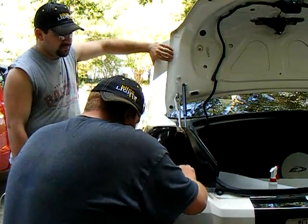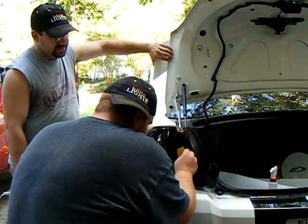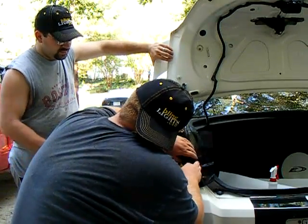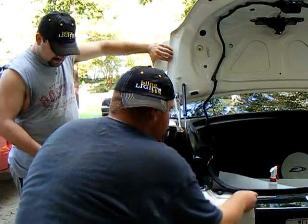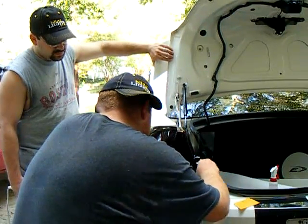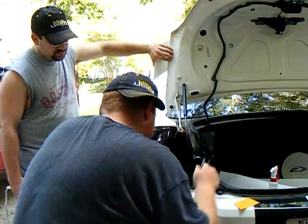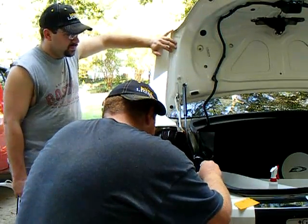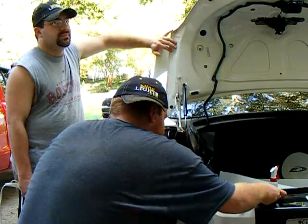Being that this taillight is fairly contoured on every angle, take this and wrap it around the edge of the taillight. You might have to make some relief cuts on the tint, make it easier to move it and do what you got to do with it, especially in corners.